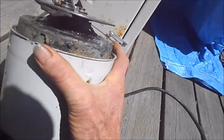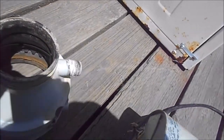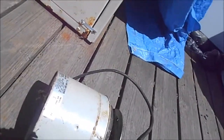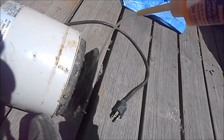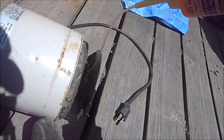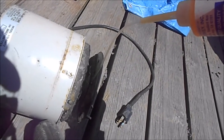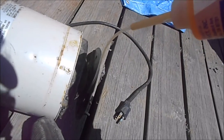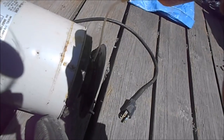I have it all gooped up now - it's pretty well sealed up. What I'm going to do is put a little bit of oil on the main shaft. I'll take the oil gun and oil the shaft here. You can see there's a little bit of rust down there - I want to coat any of that rust, get some down in the shaft, wiggle the shaft around, maybe turn it on and spin it a few times to work it in.